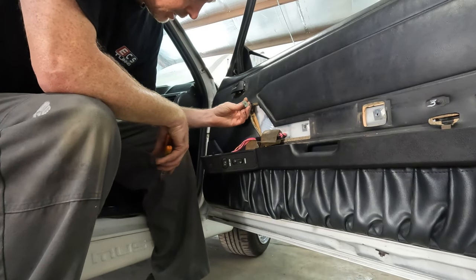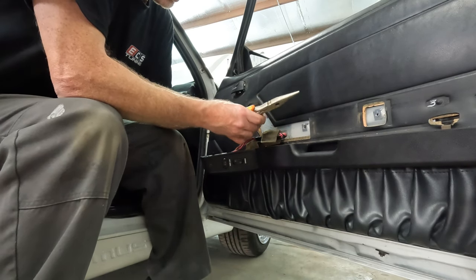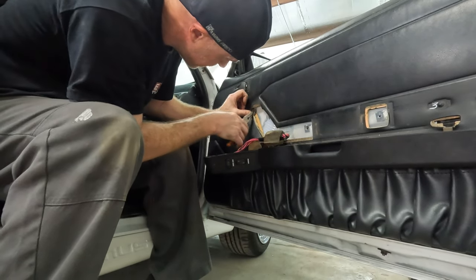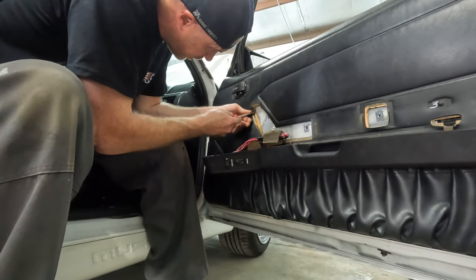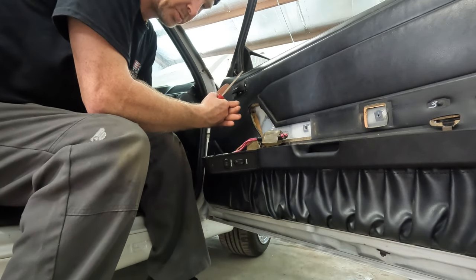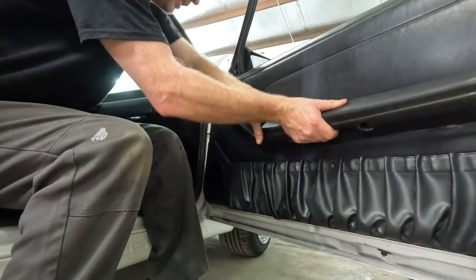So there's a remaining issue here — you can see where the factory clip for the top of the armrest goes on the door panel, and it's ripped that right off. What I'm actually doing is I have a different clip here where the position of the hole is a little bit further down. I've ground off the sides a little bit, and I'm actually going to put it onto the door itself. So I'm just going to sneak it up in here like this. What that should allow me to do is clamp onto the door instead of the door panel — and that's actually going to work much nicer. They should have done it this way from the factory. So now we've got a clip that's going to grab that and not the door panel.